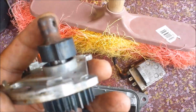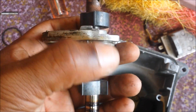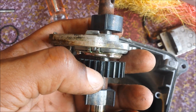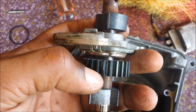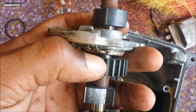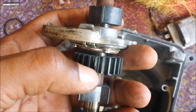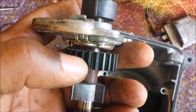Normally, if you want to run sequential injection you'd be using this 24-tooth and this single tooth. In my case I'm just going to be using this single tooth by removing this tooth right here, which will be in line with this tooth. So instead of a 24-plus-one it will be a 24-minus-one, which essentially works out to be the same thing in the software. If you don't want to modify your distributor you can keep both teeth. In my case I'm removing this tooth for sequential injection with just the one gear. But for the red hatch we're going to be using my gear which I already modified.